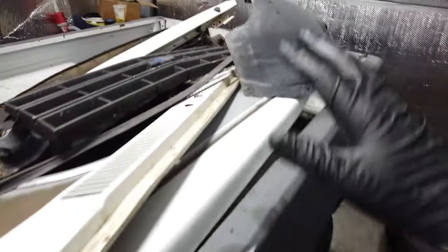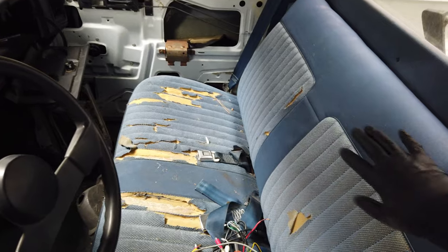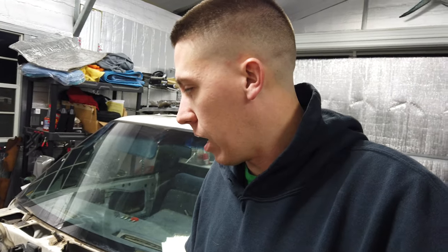Looked at all the bed sides and all that stuff looks pretty good. Got the interior kind of cleaned up. Definitely don't have a door panel over there. I would like to do some sort of different seats — thinking a racing seat would be pretty good for this since I like trying to do burnouts and spin the truck around a lot; it's trying to hold yourself in it pretty well. I did get some engine mounts coming off of eBay, the transmission cross member that Motion makes to bolt a powerglide right into a stock chassis, and also the muscle car GM pan, which is supposedly the right pan to use to give you some decent clearance and also clear the K-member without having to cut it or add a bar. Trying to keep it simple — if something happens, we go full send, break an engine somewhere, hopefully we can just swap it out pretty easy and keep rolling.